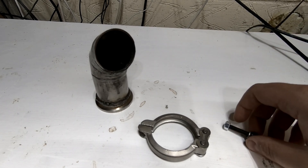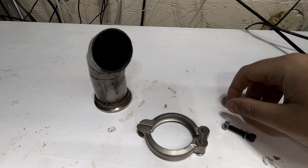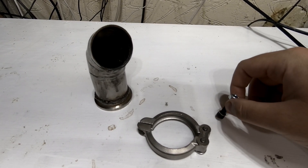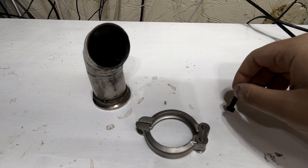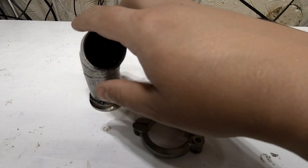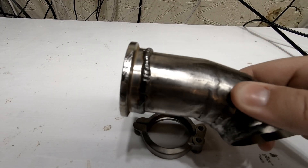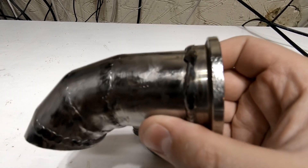In the last video you might have seen me doing some test runs whilst driving with the wastegate, which is now dumping exhaust gas out at certain RPMs — around 6000 RPM for me, or 6-7 PSI. I managed to get the flange that comes with it and used some pie cuts and my MIG welder just to turn a bit of 44mm pipe.